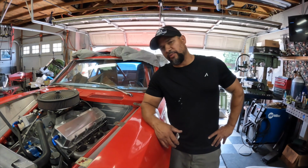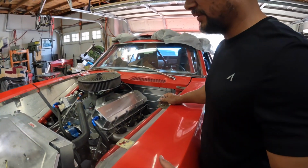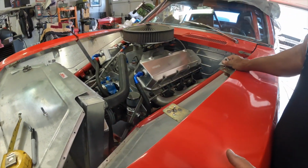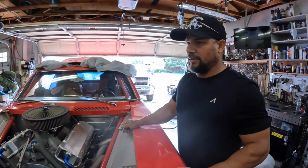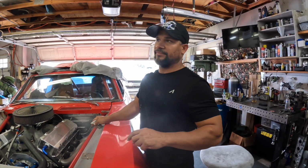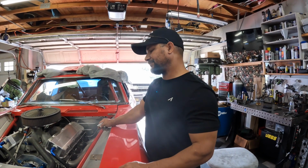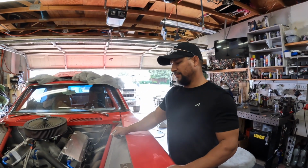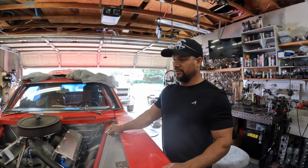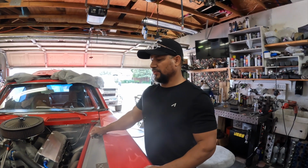Working on multiple projects today. One of them happens to be the '69 Camaro. It had a drag racing style radiator in it, and by that I mean a small, limited duty cycle. So we had to rearrange all the mounts, so we need a larger capacity radiator with more reserve capacity.